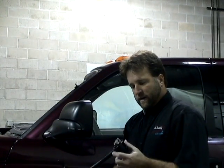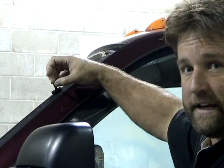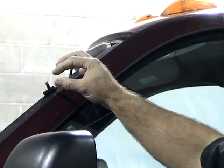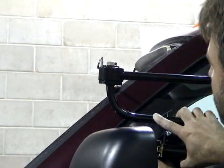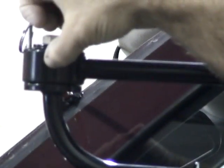So to start with, we talked about the initial setup of the base cup. Now, we mentioned the 9 inches down to our line here, 9 inches, by using the cup and measuring down 9 inches. We put the stick here again so you can see where the 9 inches is. We placed the base cup on the door glass and we told you to put the 9-inch measurement straight through the center of the block.